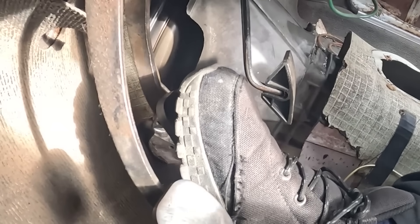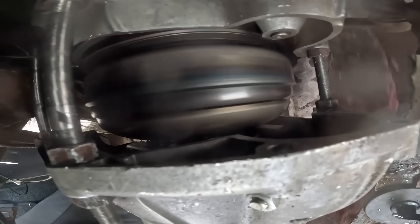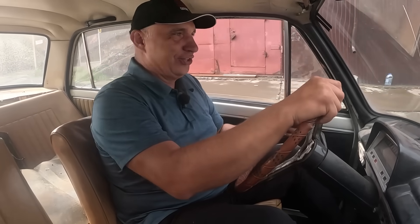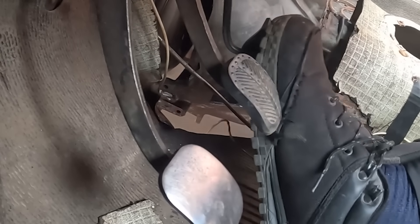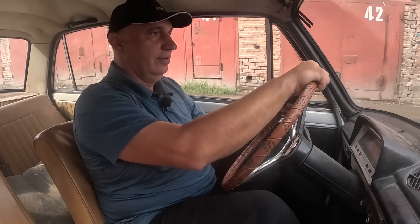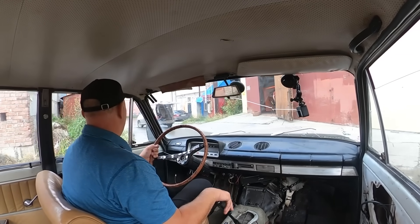What if I give it some gas? I'd better try it out first. It drives — it's not as snappy as a regular manual car would be, but we are moving along quite nicely. Let me go for third — we are in third gear. A bit of gas and off we go. We were worried that the torque converter lockup might engage, but it doesn't seem to be for whatever reason. Though that might not necessarily be a good thing.